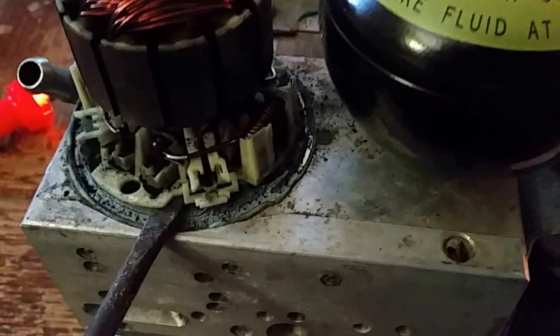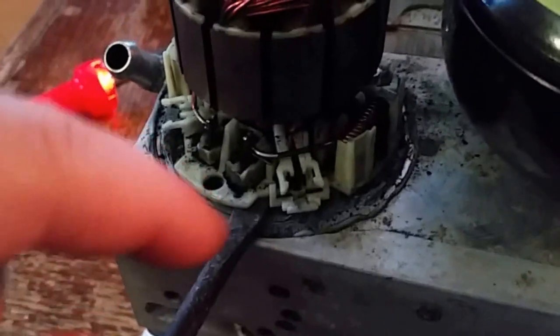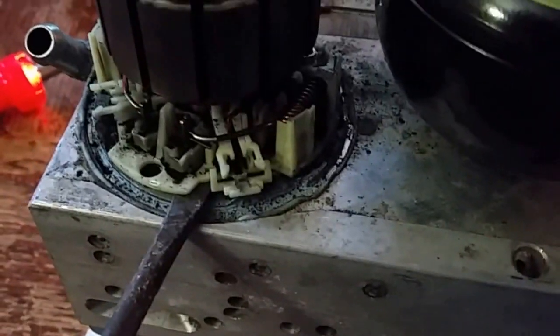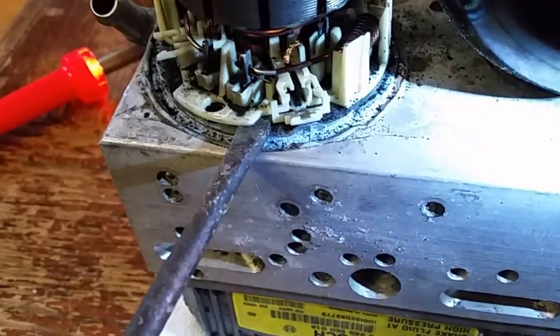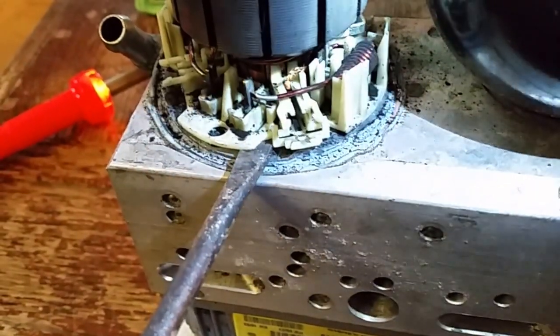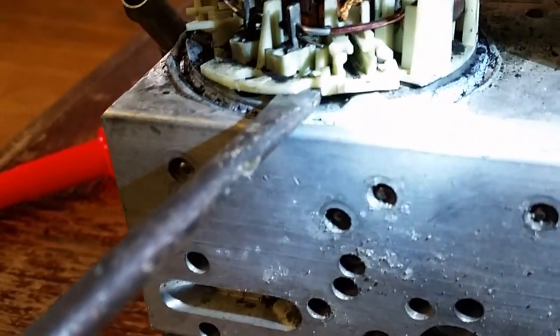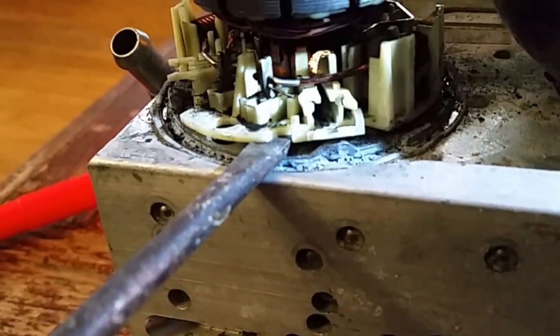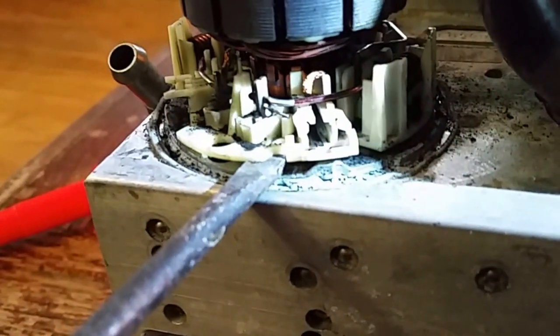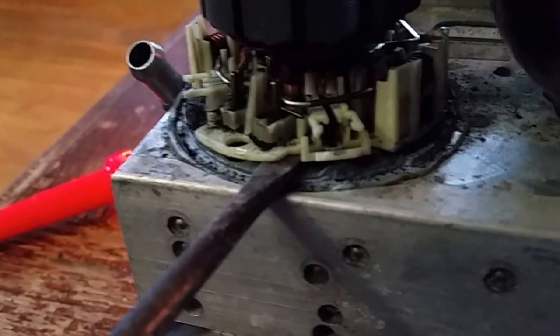Let me show you what I'm doing next. I've got the pump here — you remember this from the last video. I've wedged a screwdriver underneath the plastic here, and that lifts the pump up some. That lifts this base up so the little flapper door can go down lower, because it hits a little ridge there. You have to lift that base up in order to be able to slide in the new brush.